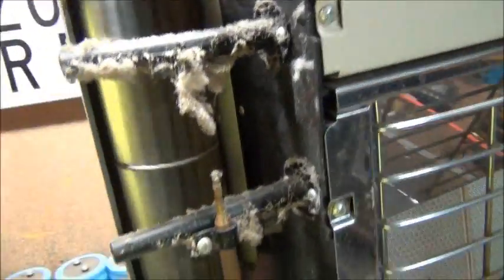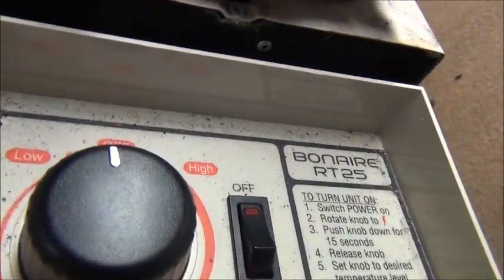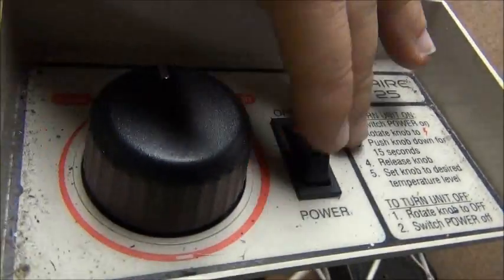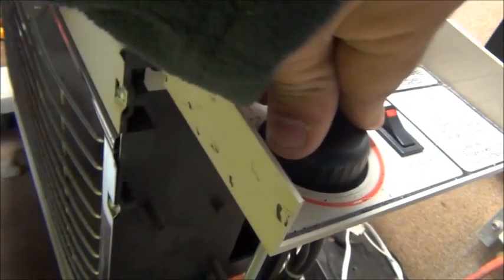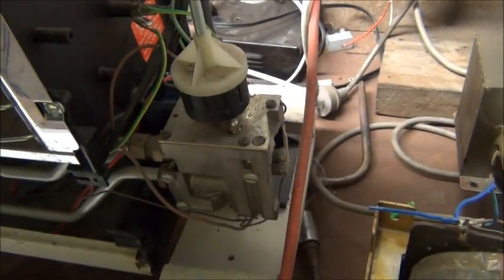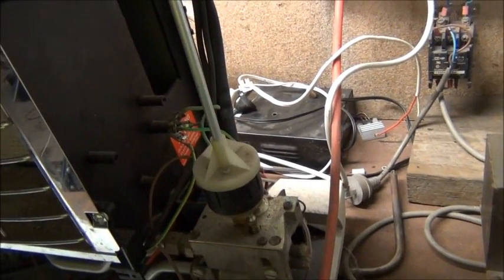It's just a little shaded-pole motor which runs a squirrel-cage type fan — that's all there is to it. There's no actual adjustment for the fan speed; it's fixed, you just turn it on. So literally: you turn the power on, turn the knob to start, push it down — click click click — it ignites, and you hold it down until the gas valve senses the heat and holds. Then you can take it off and adjust the height of the flame.